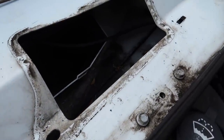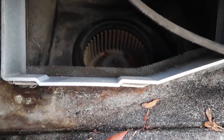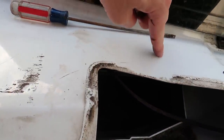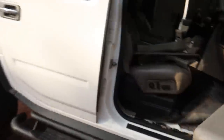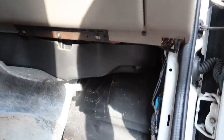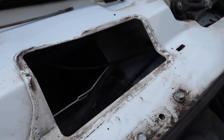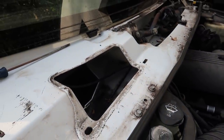Now that the valance is off, down through this little chute here is the fan for the air conditioning system. The water running in is dropping right down into this chute and into the fan motor, which is basically right underneath on the inside of the car. So that's where it's leaking in, filling up, running down, and ending up in the carpet. That looks like the issue. I'm going to clean all of this up, then reseal it and put everything back together.